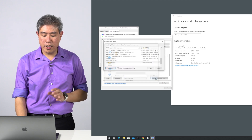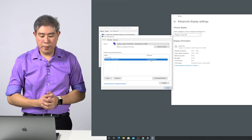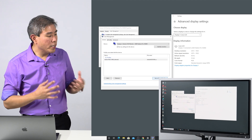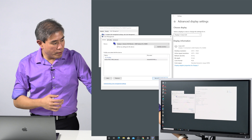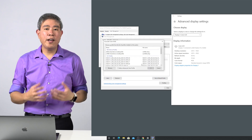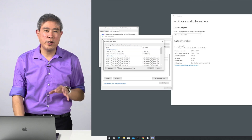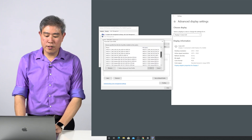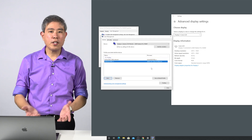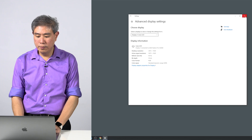Once you've downloaded and extracted the ICC profile, click on Browse and find it. I'm going to cancel out since it's already on my system. I'm highlighting Adobe RGB 1998 and pressing OK. If I want to set this profile as the default, I can click 'Set as Default Profile.' Now I also want to set up sRGB, so I'll change my display to sRGB mode, click Add again, and find the generic sRGB profile — scroll to the bottom and find the long sRGB filename. Click OK, and once you're done, close everything out.